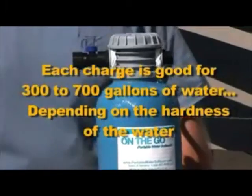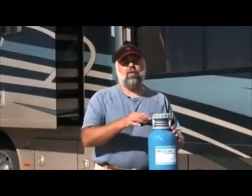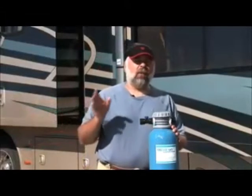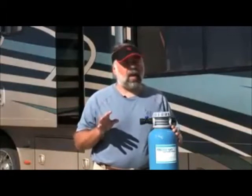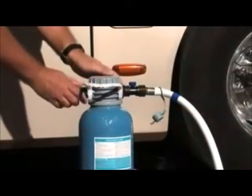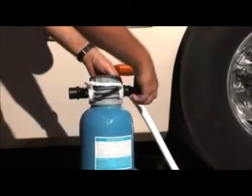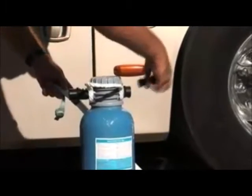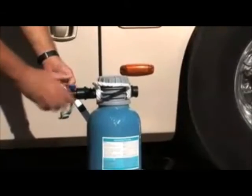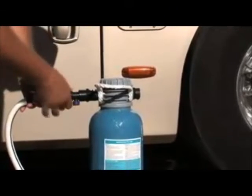Recharging or regenerating is a very simple process. Shut off the valve and unhook the water from the faucet. If you've used it for a month or so, you also want to back flush it. Use the black backflush adapter provided, put it on the outgoing part of the unit, and run your hose from the faucet bib into it — running water backwards through the unit. Start slowly for a few minutes, then increase the pressure for several minutes. Back flush the unit monthly or before regenerating.